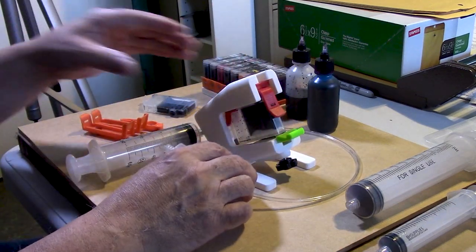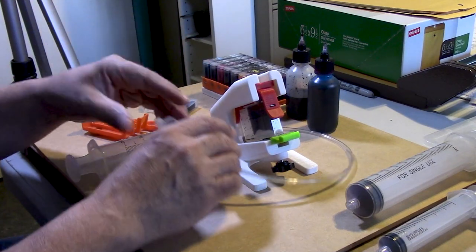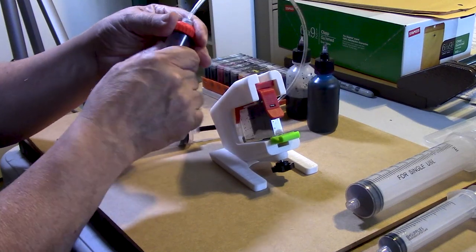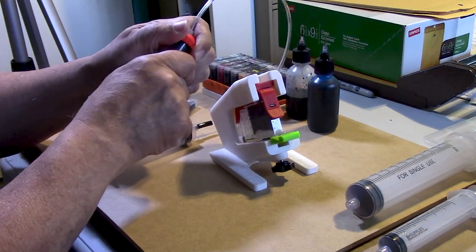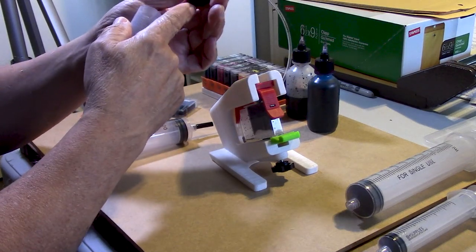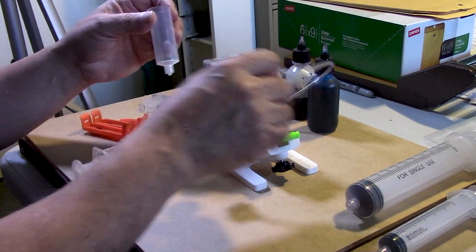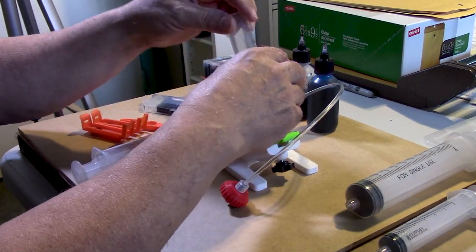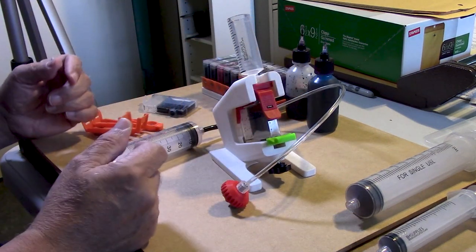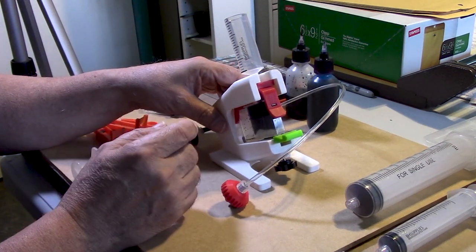Now, in order to be able to inject ink into the cartridge via vacuum, we need a special little adapter. This comes with the kit. We're going to remove the lid. Basically, it just pulls out. It's a seal type, rubber type end. We're going to attach this to the Luer lock on the holder. And now what we're going to do is preload about 11 milliliters of ink,